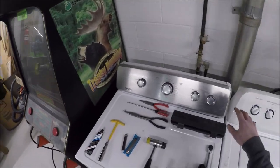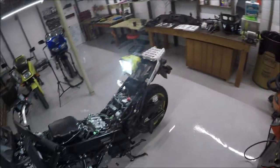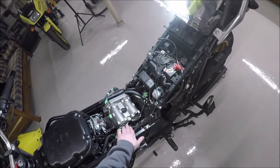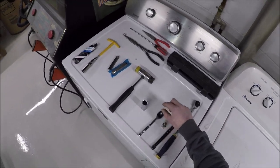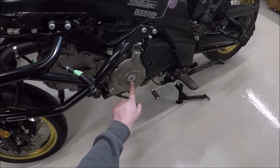A torque wrench — technically you don't need it — but these bolts on top of here, the factory people just go nuts and over-tighten them. It's only supposed to be 126 inch-pounds, about 10 and a half foot-pounds. And then we're going to need an 8, a 10, and a 6. The 6 goes in here to pull those off, the 10 is to pull this off so we can put a 17 millimeter on the crank.